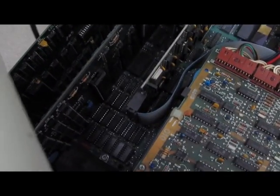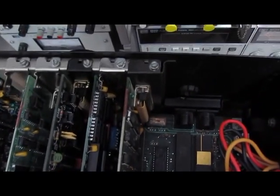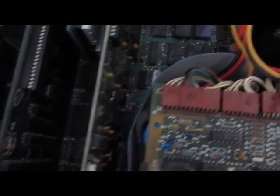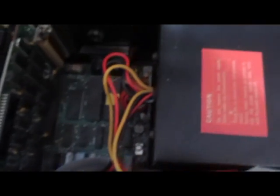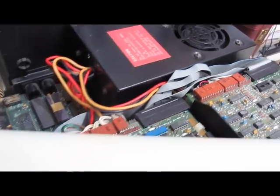I've gone ahead and cleaned the second floppy drive's heads. I've also gone ahead and installed our Z80 CPU card. I suspect the way this worked — the way I remember this board working — is you had to map this into some of the memory area of the PC, so the memory on this is actually shared between the PC and this card. I suspect now that's going to get rid of our memory error and it should be okay to boot.